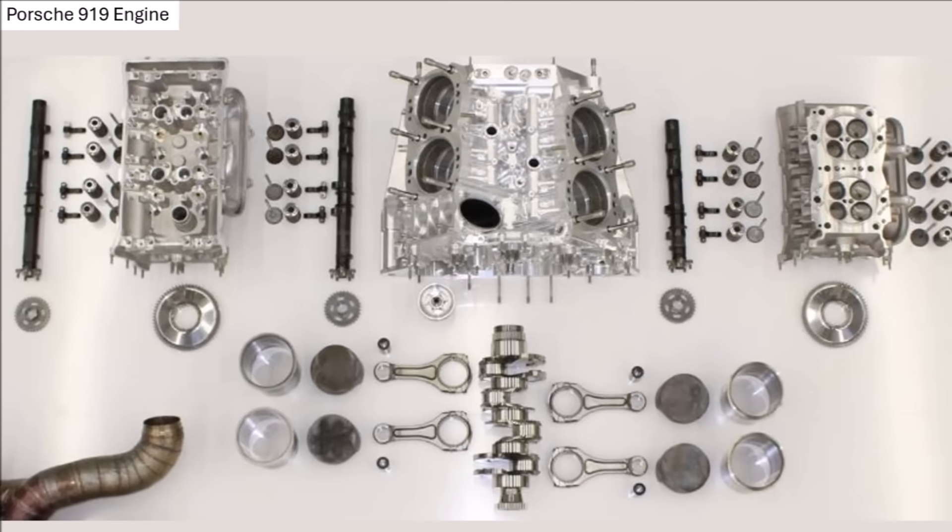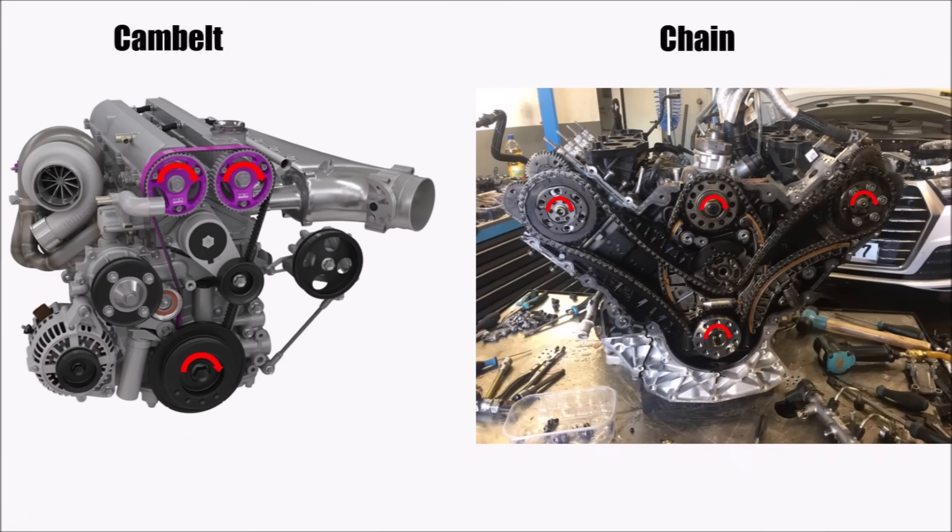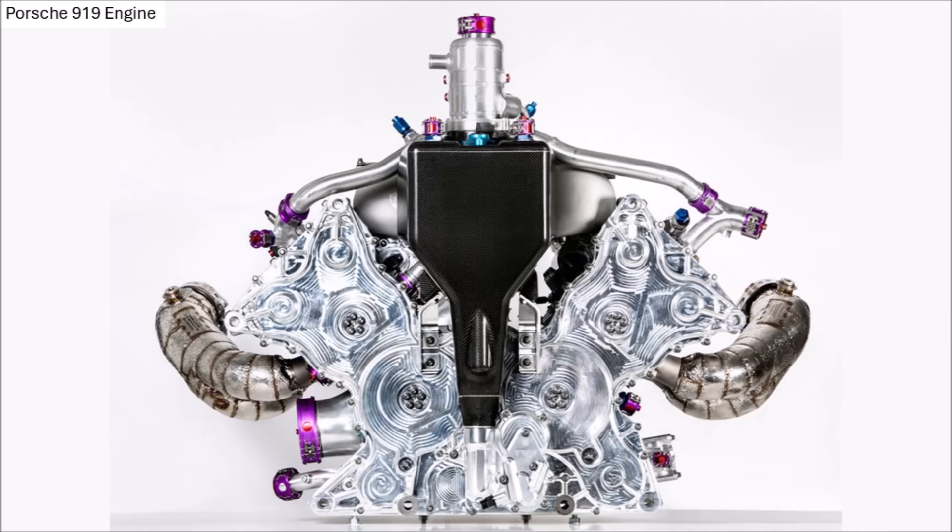To confirm this we can check the camshafts. On a normal engine with a cam belt or chain, camshafts always rotate in the same direction as the crankshaft — but of course, not here. That was one detail I overlooked last time. If you drive camshafts with gears, it depends on the number of gears whether your camshafts rotate in the same direction or not. For uneven numbers of gears it rotates the same direction. But if we look at the Porsche engine, we can see a small gear on the crankshaft, 2 large gears of the same size in between, and 2 smaller wheels for the camshafts. So from crank to camshaft it's an even number, and hence camshafts rotate in the opposite direction, which doesn't really help if you want to understand this engine. For a gear drive, it's important that camshafts rotate at half the speed of the crankshaft since it's a 4-stroke engine, but the number of teeth on the intermediate gears doesn't affect the overall ratio — just the direction can change.